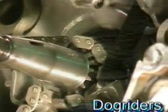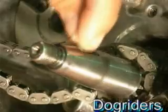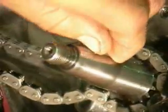It's off. Take the nut off, the washer, the flywheel — and there's the metal shaft that is jammed on very hard. There's the cam chain — see it? The crankshaft. Woodruff key — that keeps the flywheel from sliding sideways on the shaft and keeps the timing in order. Make sure you put that back. It goes in that little slot there. Just before you put the flywheel on, you have to put that woodruff key back in.